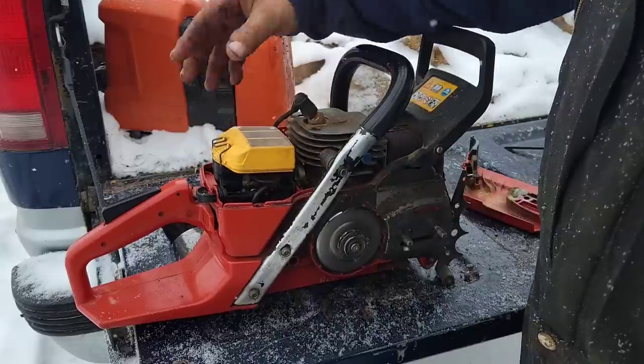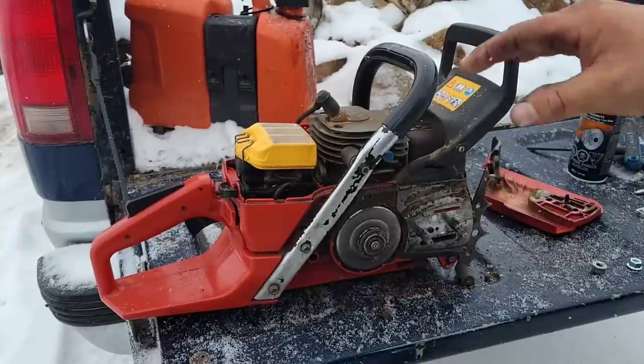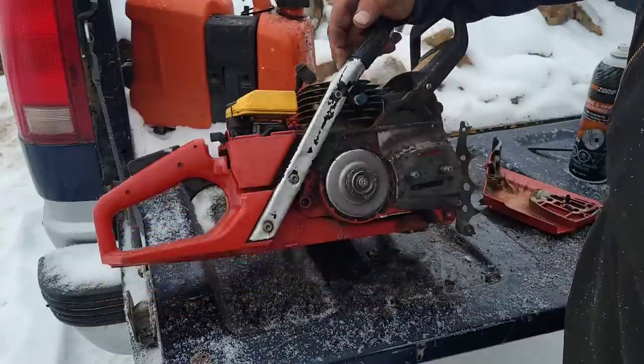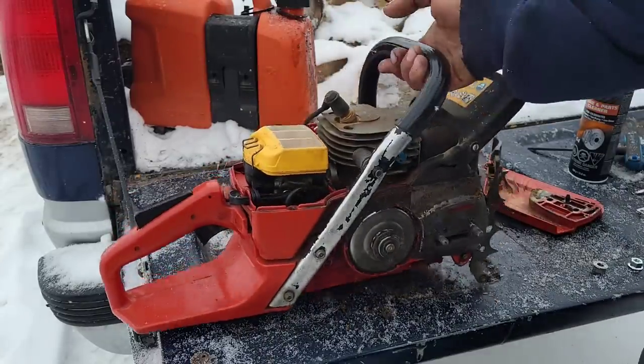It has about the best anti-vibe up until the new saws. Let's be honest, friends. The new saws are smooth. But, these are great saws. 48 millimeter bore, 36 millimeter stroke. So she's got grunt. Basically, if you've never been inside one of these, this is a miniature version of a 372.